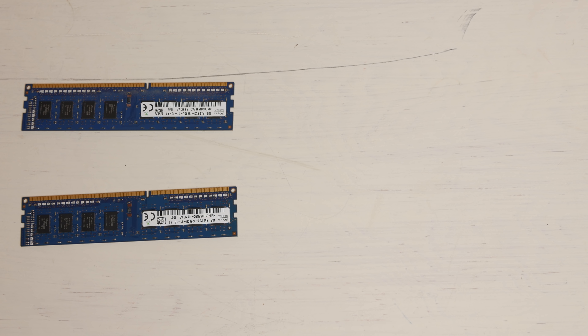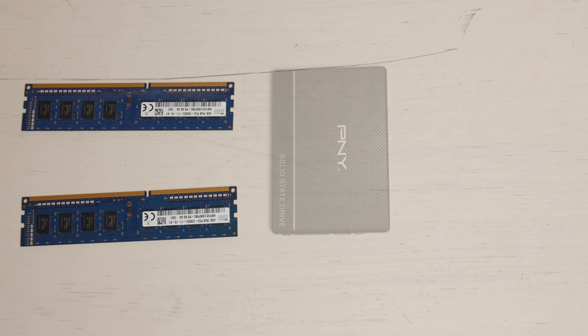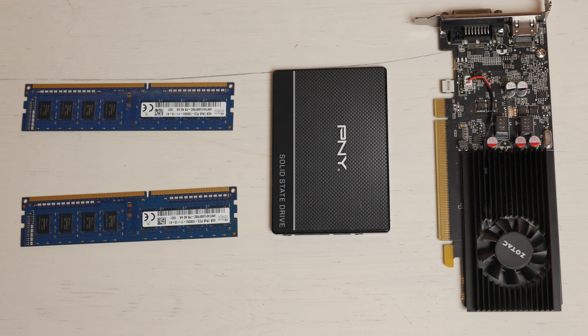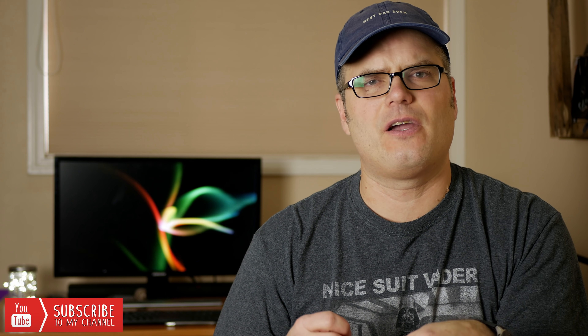There are plenty of upgrades you can do to this machine to make it run much better. You can add more RAM — I recommend that. You can swap out that spinning drive for an SSD — definitely recommend doing that one. And I would also recommend adding a dedicated video card. This is a small form factor machine, so you need a low profile card, but those are available from both AMD and NVIDIA. If you're going to be running Mojave, go with AMD, because at the time of this video there are no web drivers available for NVIDIA for Mojave. You can get NVIDIA cards to work using the web drivers from High Sierra and a little trickery, but it's a pain and people have had all kinds of problems with it. So if you're planning on upgrading the video card and going with Mojave, get an AMD low profile card.